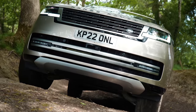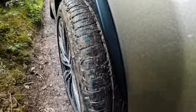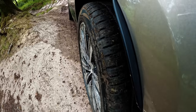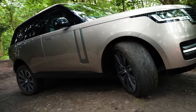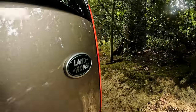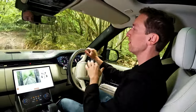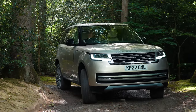Being a Range Rover it also has to be amazing off-road, and the good news is this new model definitely is. Ground clearance is 295 millimeters and you can get an additional 145mm in the highest of the four suspension settings. It's got a really good approach and departure angle, so you've got a good chance of not scraping the front or back on steep hills, and it can wade through water up to 900mm deep. Visibility is brilliant off-road too, because you have off-road cameras that give you a view of what's beneath you when cresting a blind hill, plus side views of the alloys so you can see if you're about to crack a wheel on a rock.